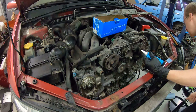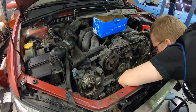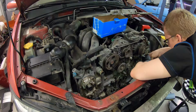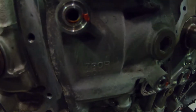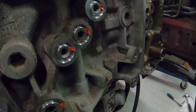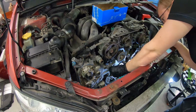And I say this because the future me is actually from a time when this car is done. The first time. Okay, what I mean by that is that it is still leaking, and I can attribute that to one of the two things I did wrong the first time around. The first error is the one I did here. It took too long from when dabbing the sealant to when the rear timing cover went on, giving the sealant ample room to cure and become a hard bulge in which the O-ring wouldn't have a chance to seal. I will cover the second error I did when we get to that part in the video.